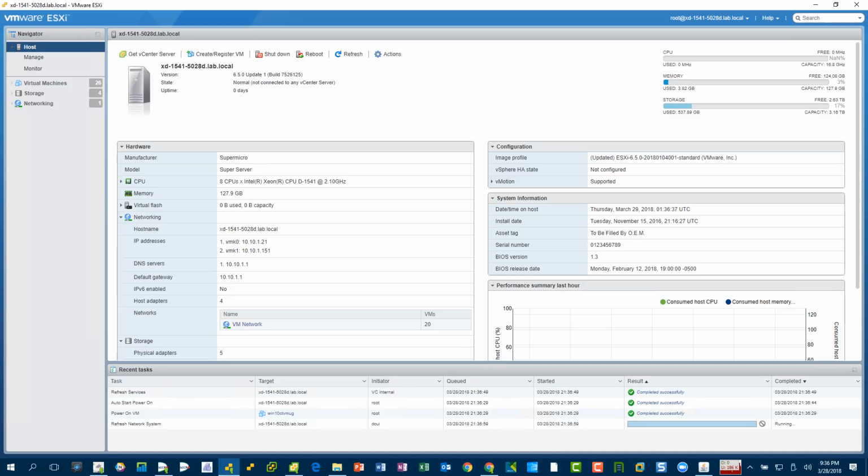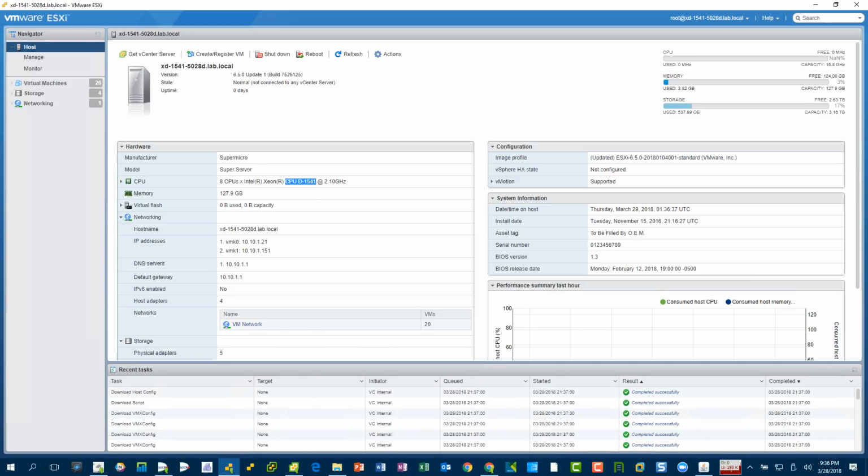and Xeon D1541. Yeah, you're wondering about the serial number. That stuff can be set with an IPMI tool. I actually had mixed success with that, but anyhow, that's for another day. The BIOS upgrade is done. Spectre Type 2 mitigation is now behind me from a BIOS level, but you also want to make sure you have the latest patch level.